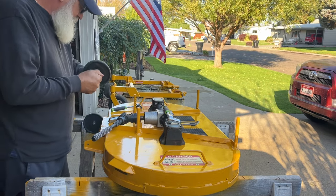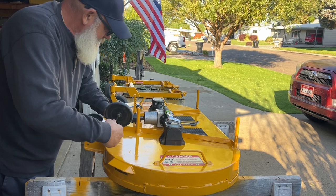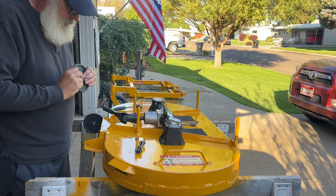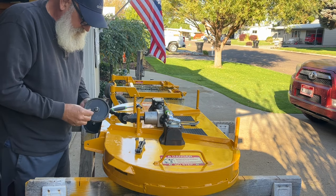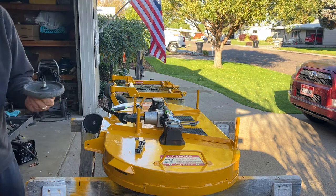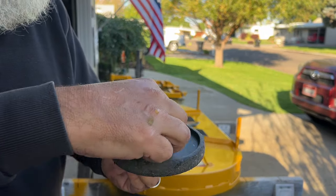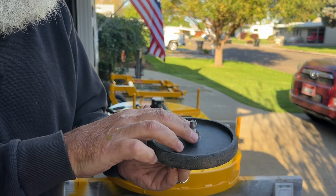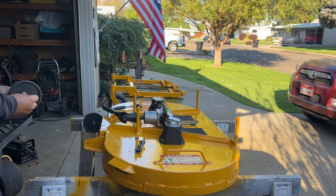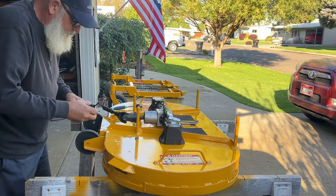Maybe you guys can see it a little better over here. I will say, these wheels have been off once upon a time because they put the spring washers on the wrong way. Here, I'll just show you. They had the spring washer that way, so the edges were rubbing into the plastic, and it's not. It's supposed to go that way. The edges go to the metal. The round portion goes to the plastic. It's always how it goes. Now, if they're both metal, it doesn't matter so much. Still, that's the right way right there.